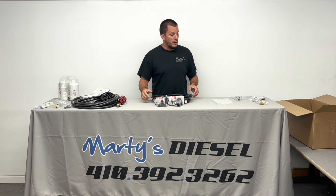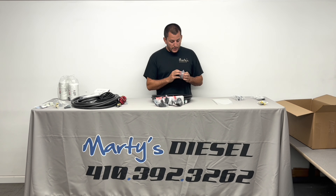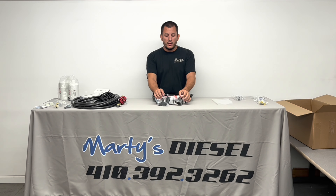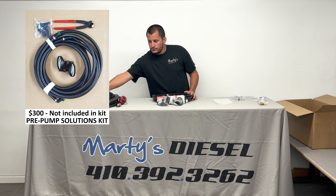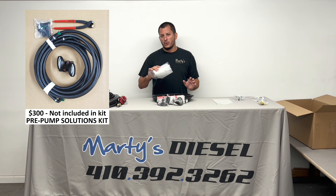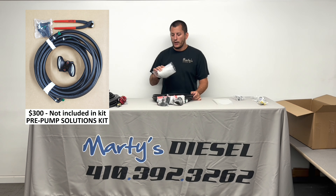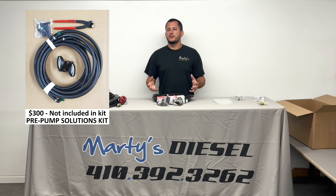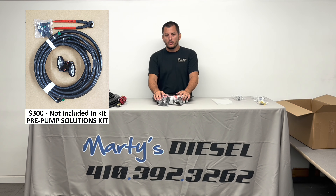Let's talk about pre-pump issues. If the needle is not in the green — maybe it's in the yellow or red — most of the time the reason is that the factory strainers inside the tanks on your sending units have come apart, and all this little black plastic is now getting sucked up into the pickup tube of your sending unit. Keep in mind that this fuel pump is rated at a much higher horsepower rating — it can support more than triple what the factory fuel pump can. So it's moving more fuel and is more likely to suck debris up off the bottom of the tank. That's why it's really important to make sure the strainers are installed on the bottom of your sending unit inside your tanks.